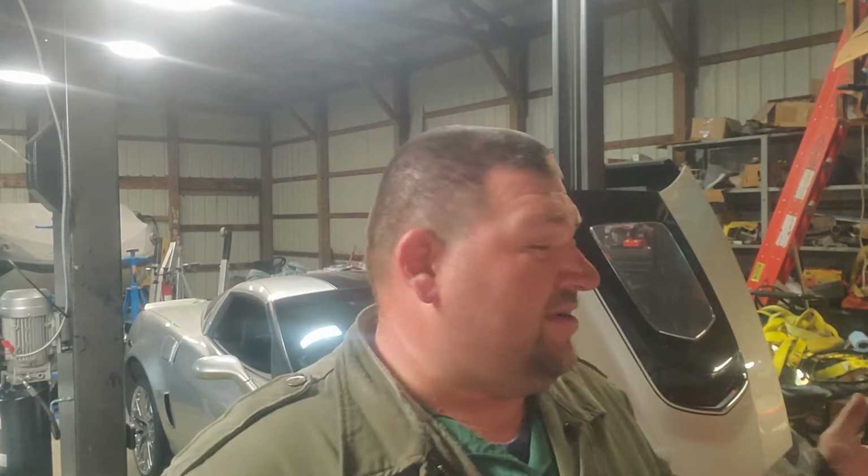with the ZR1 transmission, because the first gear is a 2.29 first gear, the first gear takes the car to like 70 miles an hour, which I like, the long gears. It's like 70, almost 100, 130, and then 4th gear I think is around 165 or 170. That's plenty, and the car has power all the time. So it might not be the fastest, but like I was saying in another video, it's not very often I come across something where it matters. You're on the street, a car beats you on the highway or something. If you're playing around, who cares?